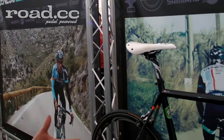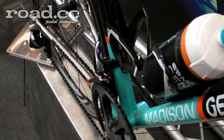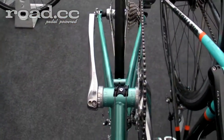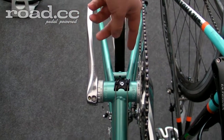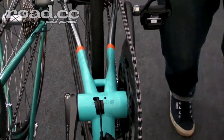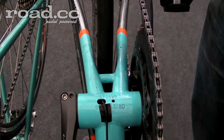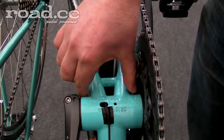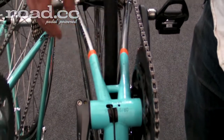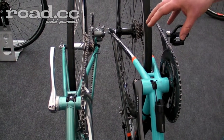The other critical feature for racing is BB stiffness — so when you pedal, the bike shoots forward. Compared to a traditional steel bike like our Equilibrium, which uses a 68mm BB with ovalised chainstays, the Volare uses a BB85 Shimano press-fit standard — basically the widest bottom bracket I could find. Onto that you've got 25mm round chainstays welding on as far apart as possible to resist lateral flex. They're quickly ovalised to bypass the tyre and chainring, then round again — super stiff.